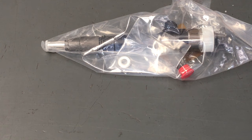What else can I tell you? That's the compensation codes. You've got to do the pilot learn on the later ones. Use TechStream. Any other scan tool that does it is generally expensive, and it's not worth you owning one unless you're in the trade, vehicle technician, whatever the case may be. So the cheapest way to do it is TechStream. All your little code reader things like your ELM or your ScanGauge or your apps and all sorts of things, they don't do this.